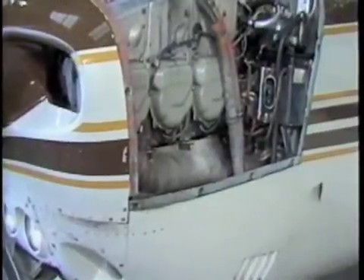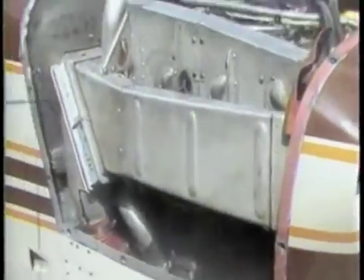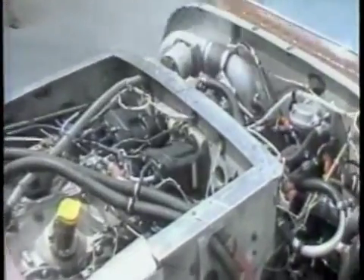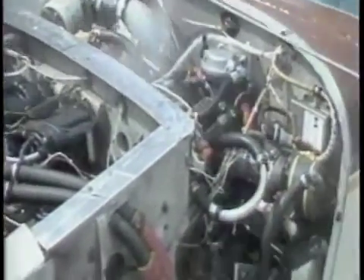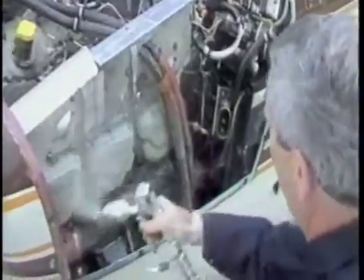Let's begin with the fuselage of our aircraft and specifically the engine and its compartment. Note: we've covered only the dry vacuum pump inlet with plastic wrap. It won't be necessary to cover other engine components, but try to avoid spraying on any belts or filters. We begin treating our engine and make an attempt to reach all areas, moving to the other side of the engine as well. You also have the option to use the cricket nozzle here to cover more area in a shorter amount of time.